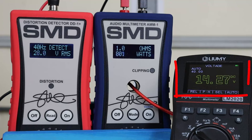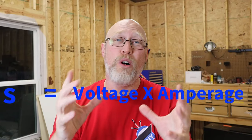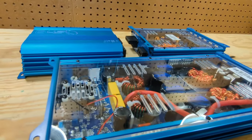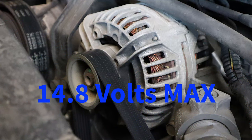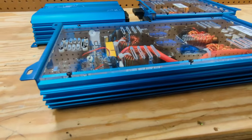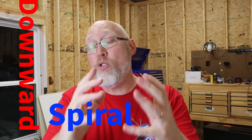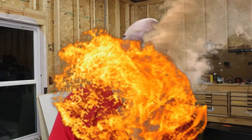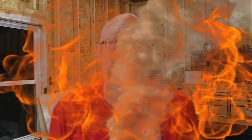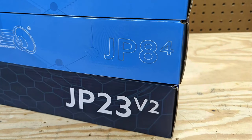At 600 watts we have plenty of voltage, and as we get into the power the voltage starts trending down. For some science: power is measured in watts. Watts equals volts times amps. If you want to make power you need voltage and you need amperage. A stock alternator will give you at best 14.8 volts. Since you can't increase the voltage you've got to increase the current, and if the voltage drops you need even more current — creating a downward spiral, because more current creates heat, heat creates resistance, resistance causes you to lose voltage, which requires more current, which makes more heat. Best case, you pop a fuse before you damage your amplifier or burn down your car.